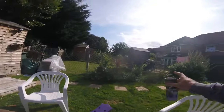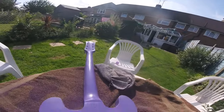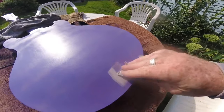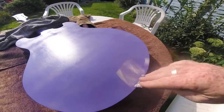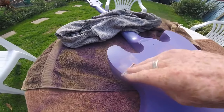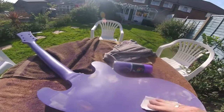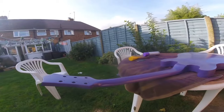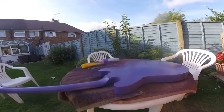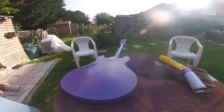This paint's very good actually — I'm quite impressed with it. It's very affordable and it looks quite striking. I'm just going around and fine filling any little bits I can see — any blemishes or scratches that are too deep to buff out. Just keep repeating this process until you're happy with the finish, then sand away, working back up the grits again, and then another coat. I left this to cure for a couple of days at this point. Still needs a bit more work but it's looking alright.